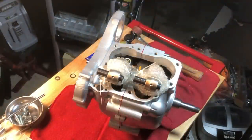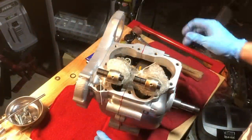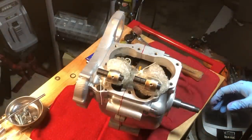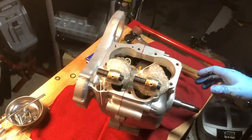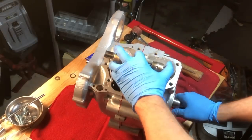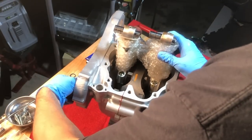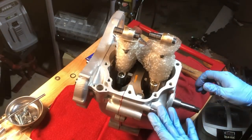And there we go. I think the trick is the locating dowels on each side - those are of course the trickiest part - but that ensures a nice tight fit. The studs on the top are pretty easy to get over. Just making sure everything still rotates - we've still got a rotating crankshaft and a rotating camshaft. We're doing really good at this point.